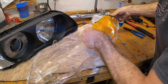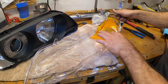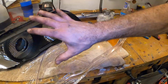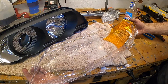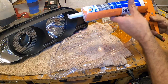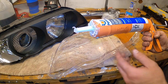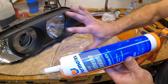So now we take this guy and slip it inside of here and make sure it sits in the right location. I'm peeling back the plastic on this because I don't want to touch the lens yet, as I'm going to be pushing up against the lens as I'm installing it. I want to peel back the plastic so that when I do install it, I'm not going to be worried about getting sealant on it. This is the sealant — a Permatex clear adhesive sealant, silicone RTV 80855. Link down in the description. I'm going to take a nice bead and put it all around the entire circumference, use my finger to bead it, and then just push the lens on.